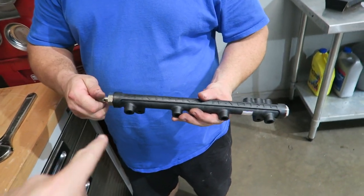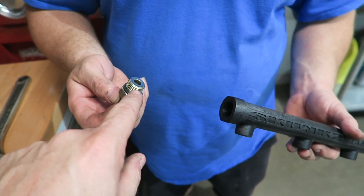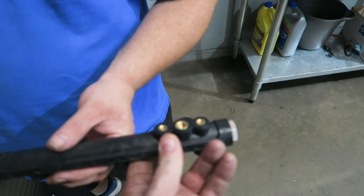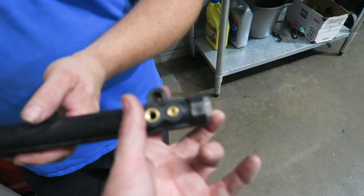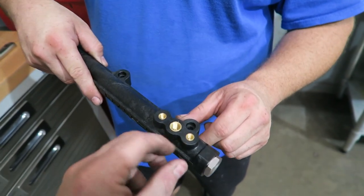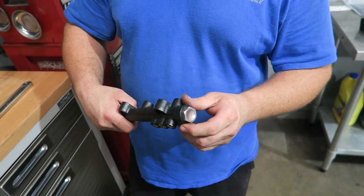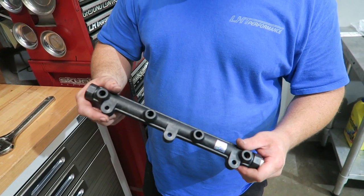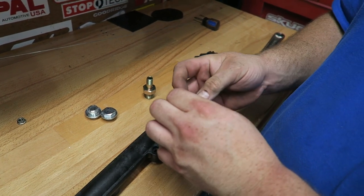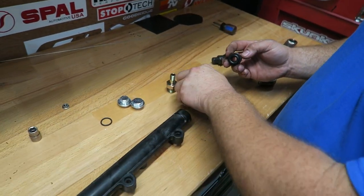One thing people will ask: this doesn't screw in — it's a factory fit, it doesn't screw, and it has a nice threaded piece. You're gonna use an O-ring. There's a bunch of companies that offer a fitting that way so we can put our dash-6 on there. We're planning to use the factory regulator — there is a threaded piece if you want to use that as a return. You can also put a fuel pressure gauge in there — that's 1/8 NPT. These are not through-drilled. The fitting is a dash-8 O-ring, which is a straight thread style and of course it needs the O-ring on there.